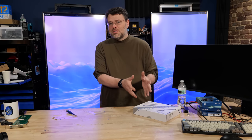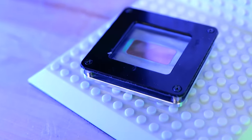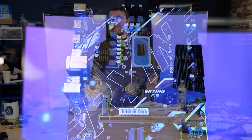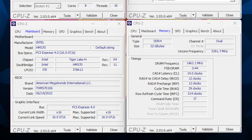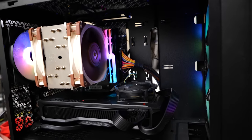That's where you run into the first quirk: physically mounting the heatsink to the processor. It comes with a shim, and the shim isn't the greatest. If you want this thing to run as well as it possibly can, you'll want to fiddle with that a little. It's BGA — ball grid array — so they've had to do some things to make a standard cooler fit. At 100 watts, you can get 4.6 GHz all-core in non-AVX loads and 4.3 GHz under AVX loads due to heat. You'll see temperature peaks of around 96°C in artificial benchmarks, but for gaming workloads you're more in the 60°C neighborhood, maybe kissing 70°C with a $30 tower cooler. Our Phanteks cooler had no problem keeping things relatively cool.